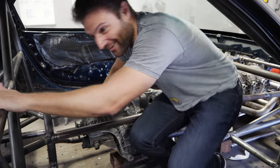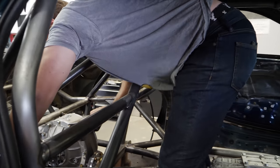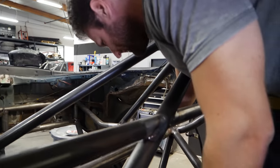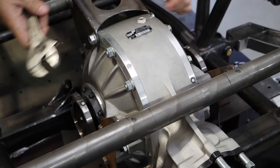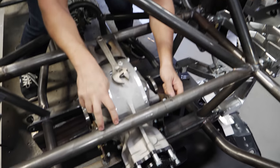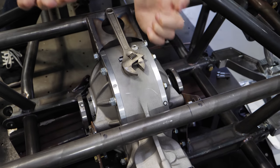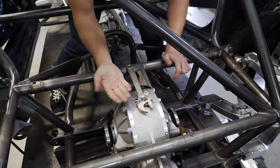One of the coolest spots — look at how much room we made for the passenger. Everything was focused on the driver, but the passenger side has more space even with the center diff right here. I'm going to see how easy it is to remove this diff now that we're in a real-world situation. It's like a jungle gym inside the car. The hard part is this ass end of it with this bar because we can't pick it straight up — it has to come out towards me, come under right here to the bottom of the car. These two plates are not removable; they're like the structural rigidity of the whole car.